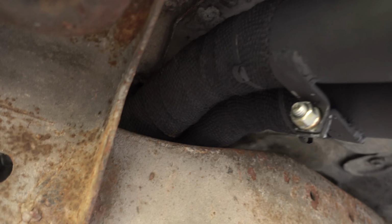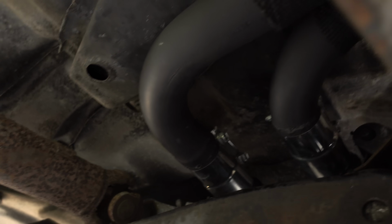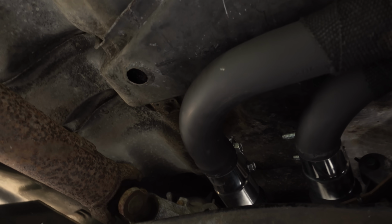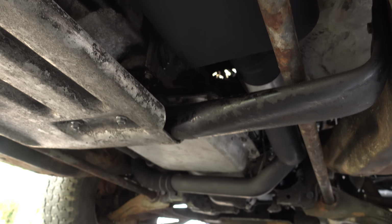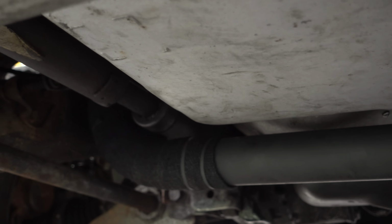Those pipes come over the transfer case cross member, through the muffler, which has hangers in the old catalytic converter mounts, and right in front of that is that Y pipe. The whole driver's side pipe is 2 1/4 inches, and the passenger side pipe is 2 1/4 to that main 2 3/4 inch down pipe.